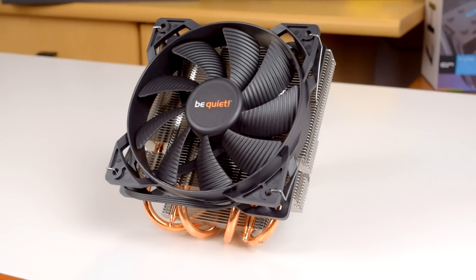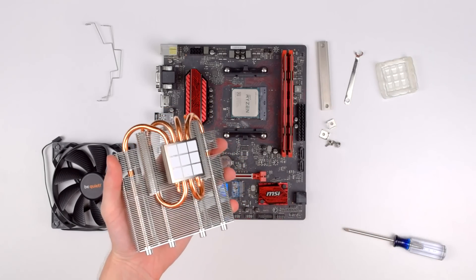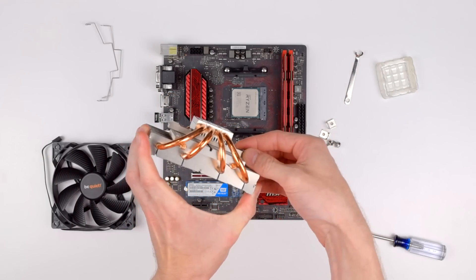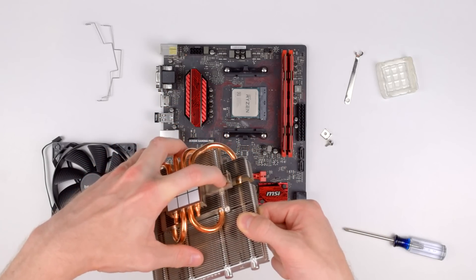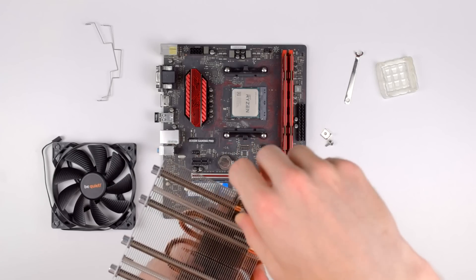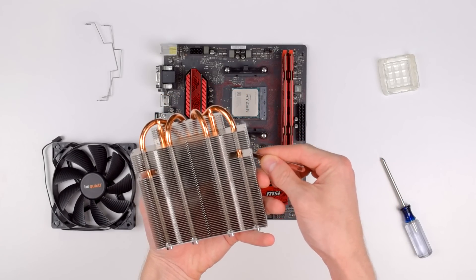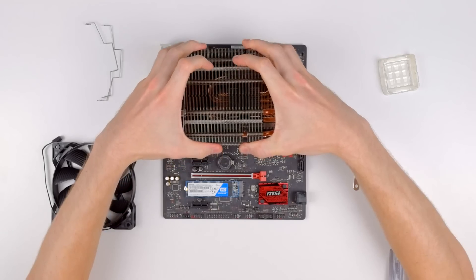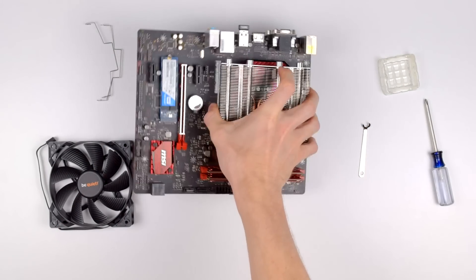That's quite a bit shorter than a standard PCIe bracket. To install the Shadowrock LP on AM4 systems, the first step is to remove the plastic cover over the base — just make sure not to touch it since it already has thermal paste applied. Next you slide the AM4 bridge between the base and the fins; it has ridges to keep it correctly lined up. Then you attach the two AM4 hooks to the bridge. This part requires a bit of dexterity because you need to hold the cooler, hold the bridge in place, hold the AM4 hook on the bridge, and then get a screw threaded through the hook. If you slide the bridge out a little bit, it makes the whole process a lot easier. BeQuiet does include a small wrench, but I found it easier to just use a screwdriver through the openings in the heatsink. You only need to tighten the AM4 hooks a few turns, leaving them loose so you can get them hooked onto the motherboard. Once you seat the cooler and make sure the hooks are hooked, you alternate tightening both screws until it's all snug. With the screws tightened down, the cooler is very firmly attached.